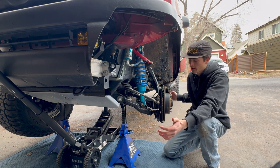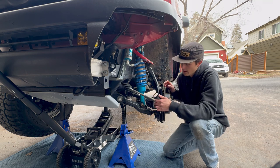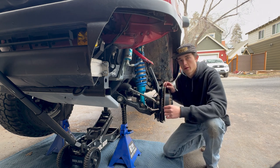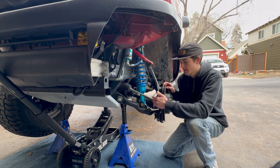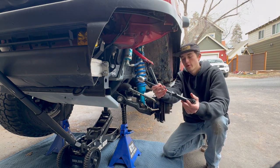How you can tell is you grab any of your tires while it's on there, shake it back and forth, have a friend look in here and you'll be able to see the play in this joint as it moves back and forth. That's going to be the source of those vibrations and shuttering. Once you're certain that it is the inner and outer tie rod, you should pick some up before you tear it apart.